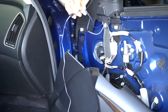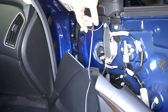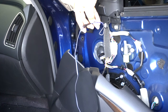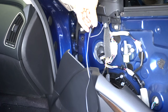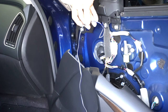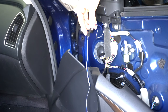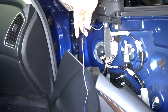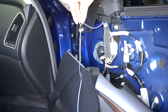We passed through the sequential wires. I pretty much used the harness that came with the lights and plugged the pins into the corresponding wires — matched up blue with blue, white with white, black with black — and pushed them in until they locked. If you're concerned about this connection you could use butt splices and crimp them, but I taped them together and wrapped the individual wires in electric tape so they don't short each other, then bundled them up together.